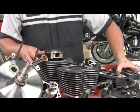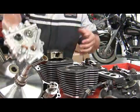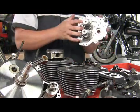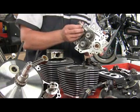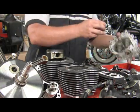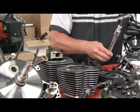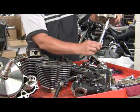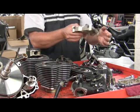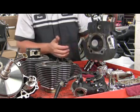To control the air flow moving in and out, we have our camshafts, which are connected to the crankshaft and turn with it. Our camshaft has lobes on it that our lifters ride around. The lifter pushes up on a pushrod, which is in a chrome tube on the outside of the engine and operates our rocker arms. When our camshaft rotates, it lifts the pushrod, which lifts the rocker arm, which pushes the valves down — initiating the air flow in and out of our combustion chamber.